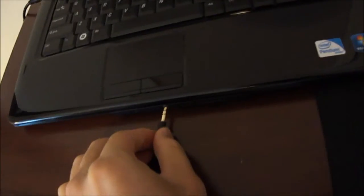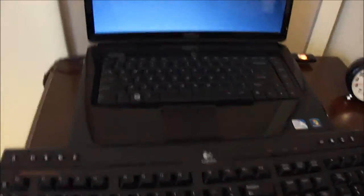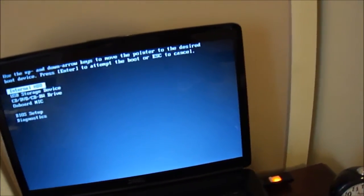Plugging in the power, plugging in the flash drive. Turning on the keyboard, pressing the power button, then pressing F12 — note that the boot menu key is different for every computer. The boot menu comes up. Selecting 'Boot from USB storage device' and pressing Enter. Windows 8 installation begins — the installation screen is very similar to Windows 7.